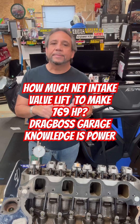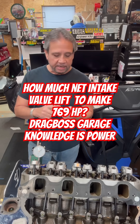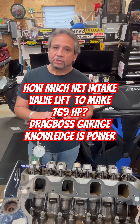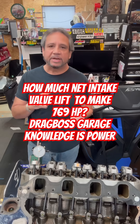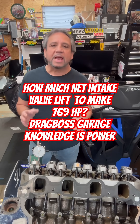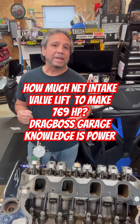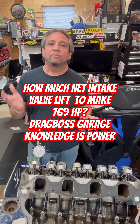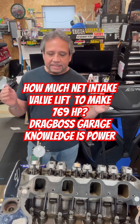So that 19 thousandths — what is it? Well, that includes the lash obviously, which is going to get a lot more than it is here with heat. Then you have friction. The biggest thing: deflection — deflection of the push rods, the rocker arm, the rocker arm ratio, the valve springs, the valve. Everything's moving, it's a dynamic situation. So instead of 19 thousandths, it's really going to probably be more in the range of anywhere from 20 to — some engines — up to 40. You have to take that into consideration. There's a lot of dynamics and changes.